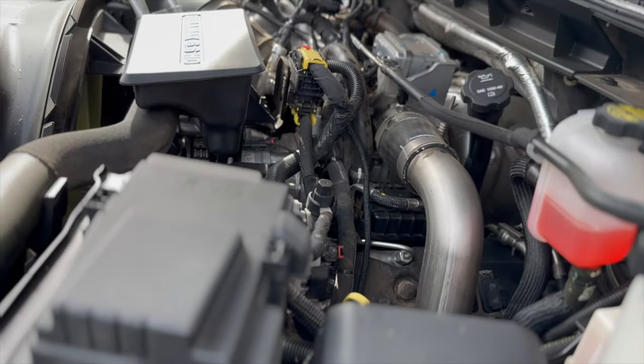It's always important to follow the instructions. I did get a little confused — I ran all three: the Derringer with the i-dash and Pedal Monster. The Derringer will actually plug into the Pedal Monster module. Banks gives you all that info with a wiring diagram showing exactly where they go, since the i-dash only has two spots to plug in. The i-dash is plugged in — just slide it in, line up the two wires, and it's a nice snug fit. Banks came a really long way with their mount — I remember having to do the whole A-pillar replacement where the color was never right and it was floppy. This thing is solid, no bouncing. Pop the trim piece back on, make sure the clips are straight and in their slots so all the seams are nice and straight.